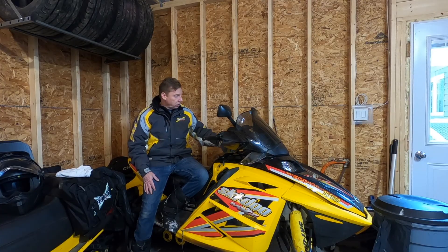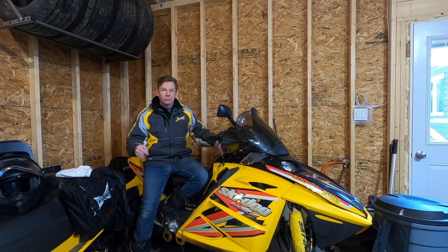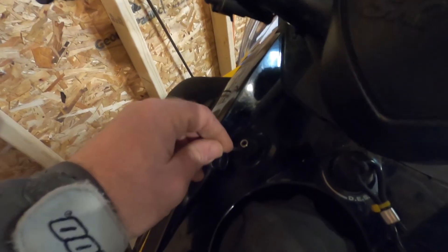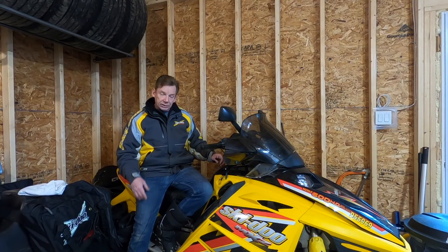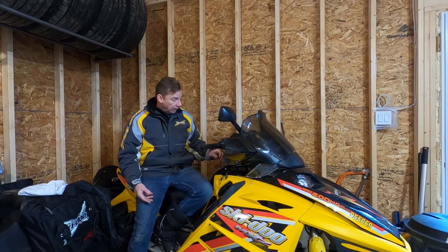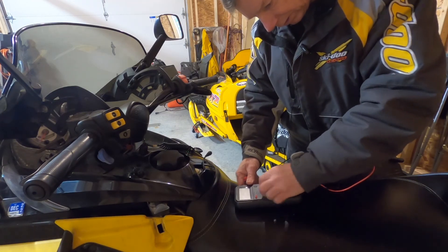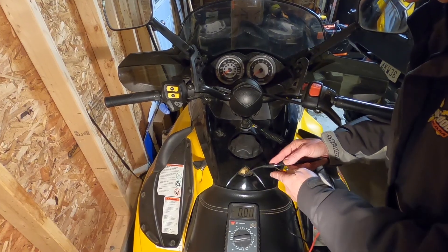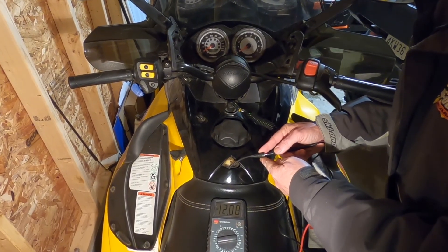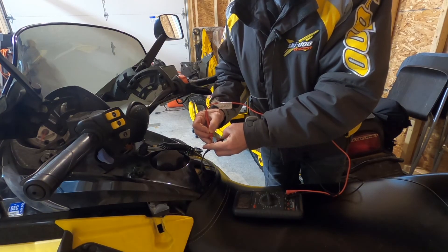Let's do another simple test for voltage. There are two plugs on this console — the manual calls it an electric visor jack connector. It's a little RCA port that you plug your heated shield into. This other one's been added as an accessory, pulled through the opening for the fuel gauge. I'm curious about how this has been wired in — is it live when the sled's not running, and which part is positive and which is negative? I select DC voltage, set it to 20, put my black probe in the middle and touch the outside. It is live, and I have that little negative symbol, telling me my red is on the negative.